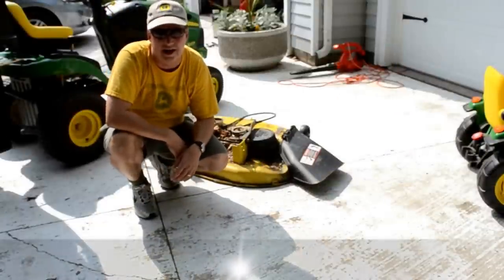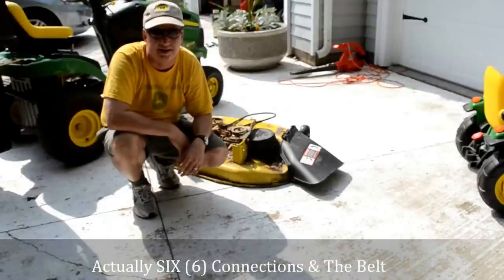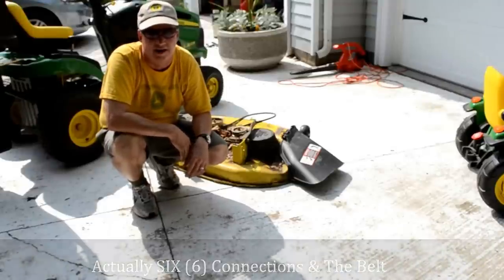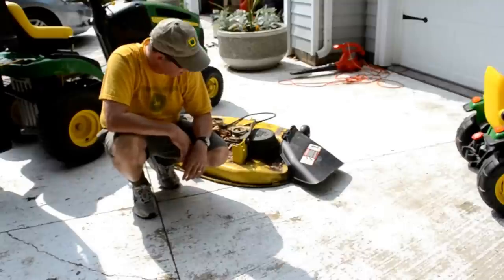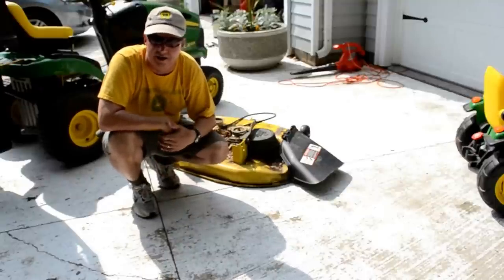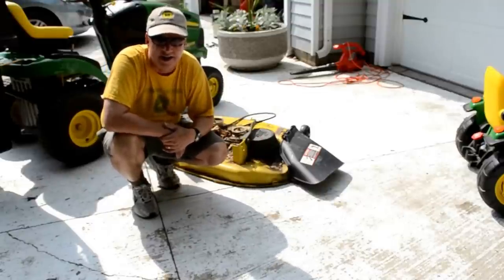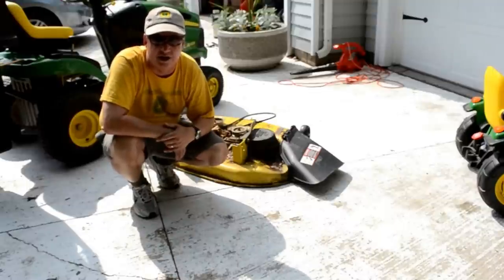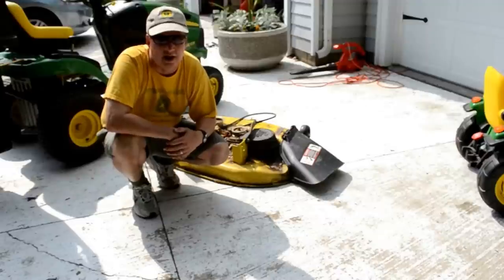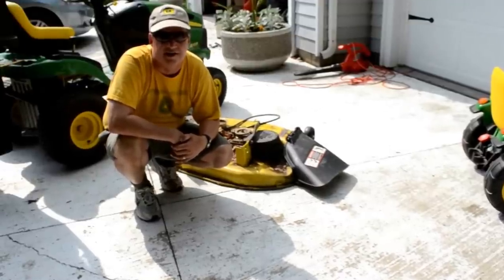Okay, that's it — you've got about five connections to undo, just cotter pins. You may need small pliers to pull, but you don't really need them if you have stronger hands. It takes about ten minutes of work and it's a lot easier if you're not using a camera. Now I'm going to clean this up with a pressure washer to get all that debris off, and in part two of this video I'll show you how to change a lawn mower blade. If you like this video, subscribe — I put new ones up every couple of days. Thanks for watching.